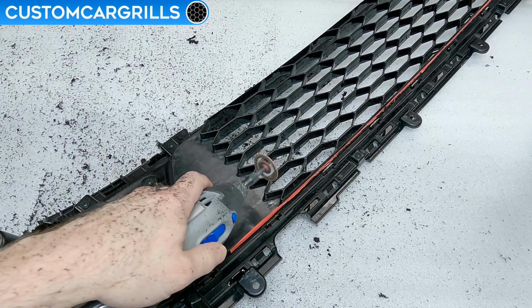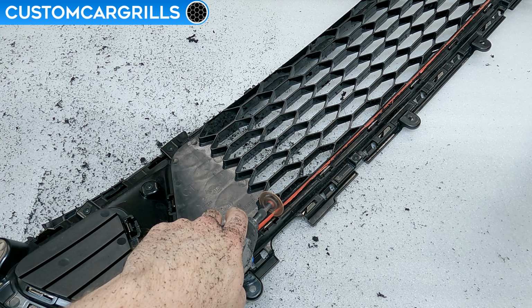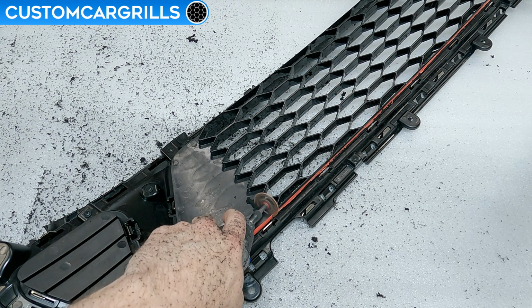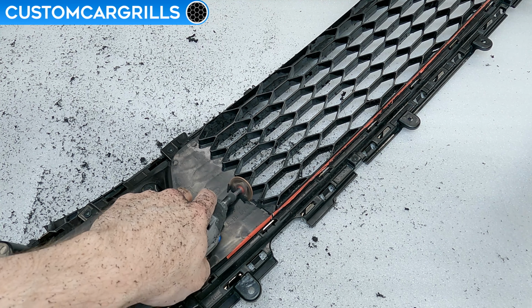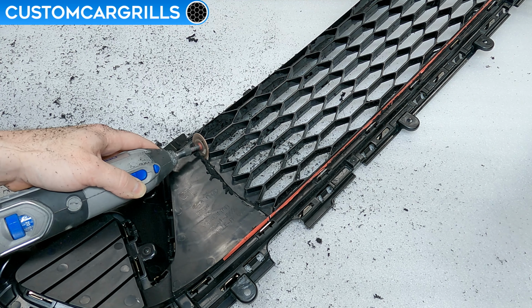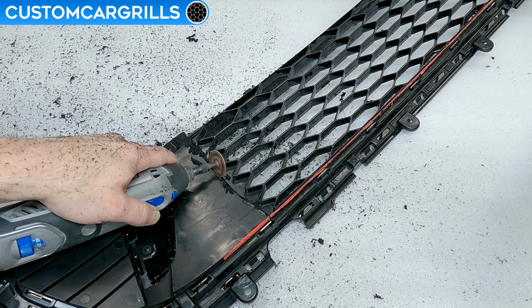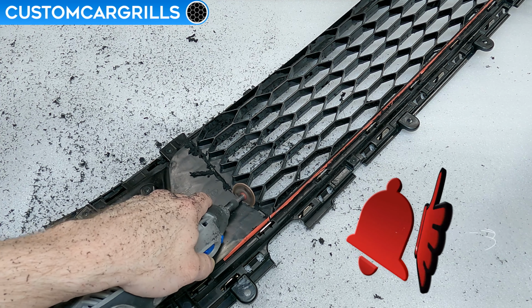Simple cuts through the areas that are stuck can be quickly made and a little less risky than the Dremel method. Once you feel that the center area will release out, then cut the solid area near where the diamonds end. It's important to note that the depth of the cut here, where it meets up with the tape line, should not be any deeper than the tape line itself. In short, the general rule of not cutting past the tape is still in effect here.